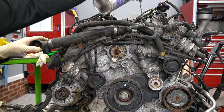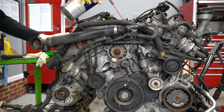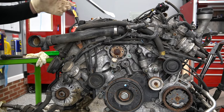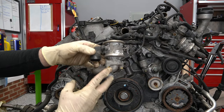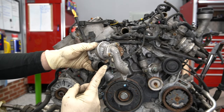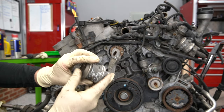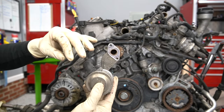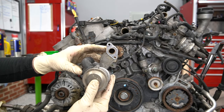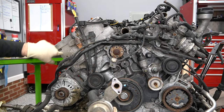Let's get rid of some of this extra stuff up front — that'll clear out a lot more space for us to see what's going on. This is a combivalve. What this does is it actually controls part of the secondary air system: air is pumped into this side, vacuum controls this valve, and that allows air to pass over the catalytic converter and warms it up faster. This one has two — one on the passenger side bank and one on the driver's side bank.